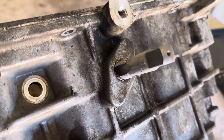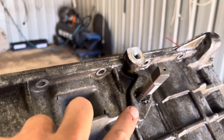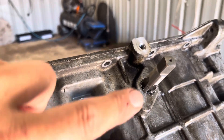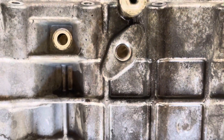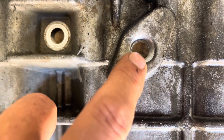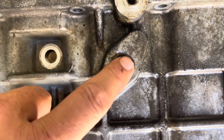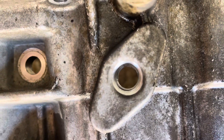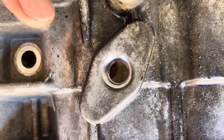As you can see, we've cranked on that some more and it's just gotten really tight all of a sudden. I've given it a few more cranks and I'm going to back it off now and get all this swarf out - back it out, clean the hole, then put the thread back in. After blowing it out with compressed air, the reason it was getting tight is it's actually hitting a step - the thread has tapped out a hole bigger than the 12mm hole we drilled, which is ideal. We want to make sure the thread is actually threaded into the sump. The hole wasn't too big for the tap, so all I need to do is get a bigger step drill bit and come from the back on the inside to take that little step out.